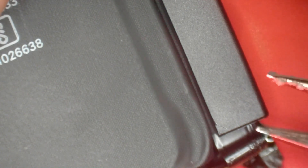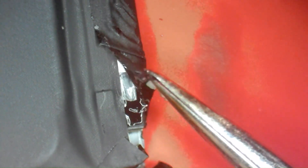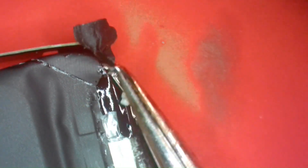Once the first layer of adhesive is removed, we can remove the plastic cover. Flip the battery over and you'll see the second layer of adhesive begin to come up and expose the leads. We're pulling up this first adhesive layer by layer. Then lift up on the plastic cover — there's a little tension from adhesive glue at a couple of key points under it. Once it's removed, set it aside; replacements are provided in the X-CAP BMS packaging.